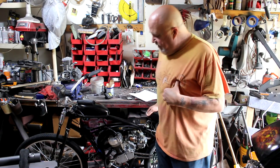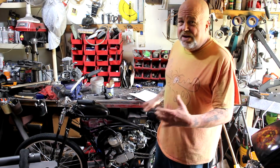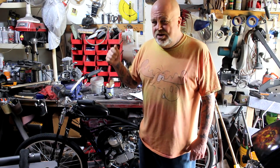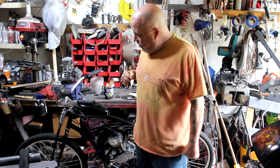All in all, I love the bike — it's fun. If I were to keep it, I'd want to go up to maybe a 40 or 44-tooth sprocket. I'm not interested in high top speeds. As it is, it doesn't have the best acceleration down low — you've got to build some revs on the motor and then give it gas. I'd guess it'll hit about 50 miles an hour once the motor's broken in, but I don't want to go that fast on a bicycle. I'd rather have lower-end performance, so I'd go with the 44-tooth sprocket on the rear.